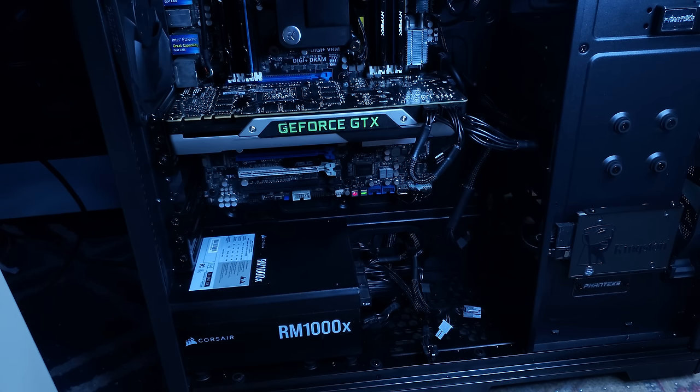Okay, hopefully it'll post this time because I would really like it to. Oh, that's not a good sign. 00 postcode. Fuck. I wonder if this motherboard's BIOS is not updated. I might need a different CPU. Do I even have like any first gen 2011 i7s or like older Xeons to throw in here to update the BIOS? I don't even know if I do have that.